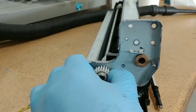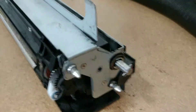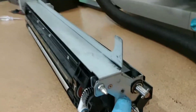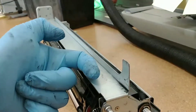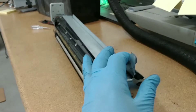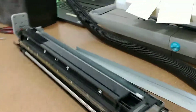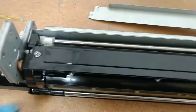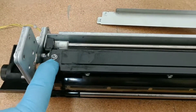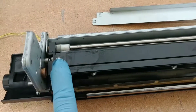Remove this gear and put that off to the side. I went ahead and removed that screw, so now that this screw has been removed, we can go ahead and pull the bracket towards our direction. Just like that — comes right off. Now that we've done that, we are able to access the screw that was hidden. All you have to do now is loosen this up and remove this cover.